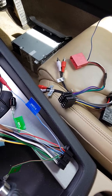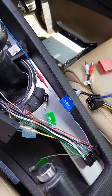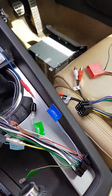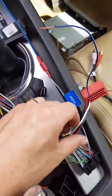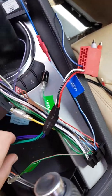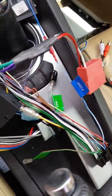This does apply to some of the other cars as well — the A3 and A4 with half-amplified audio systems. A lot of times we see people with this lead, which is the ISO block lead, and then the amplifier connector lead. This one has got a high-low converter from the speaker wires to the amplifier wires for the rears.